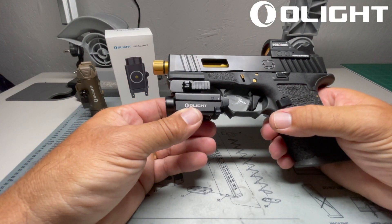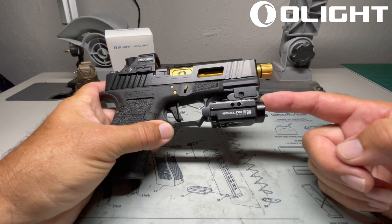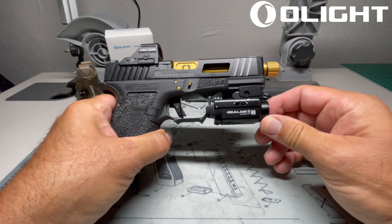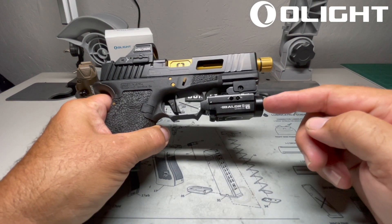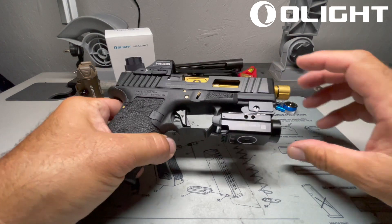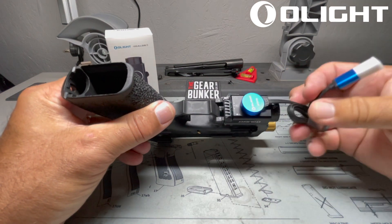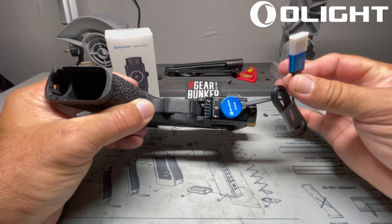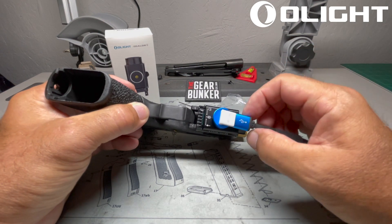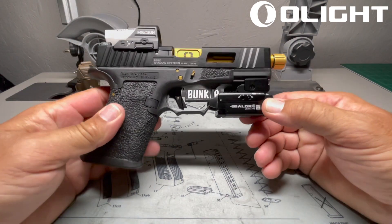Some of the specifics about the Olight Balder S: it comes with 800 lumens on max, and those maximum lumens are achieved for the first 60 seconds before the light automatically throttles from 800 lumens back down to 300 lumens for the remaining 39 minutes. So keep that in mind and keep the battery topped off at all times. They do include a clever magnetic charging USB cable, and the indicator light turns green when fully charged and red when charging — making it easy to keep this proprietary 3.7-volt onboard battery topped off.